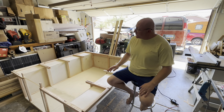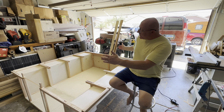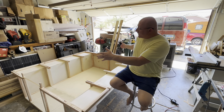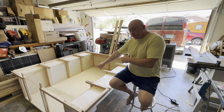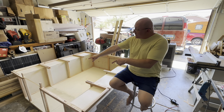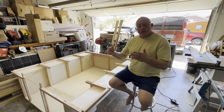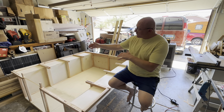For a dimensional perspective, this is very close in size to my last two truck campers — Camper 7.0 and Camper 8.0, which is my latest camper. This will actually slide into the bed of my pickup truck, which is 6 foot 5 inches long, or 77 inches, and allow you to shut the tailgate. The lower floor width of this is 49 inches, meaning it will only slide into a full-size pickup truck. The front 17 inches actually bumps out a little bit closer to where the back of the pickup truck is, toward the rear of the wheel wells, which adds a little bit of storage and stability to the tub.